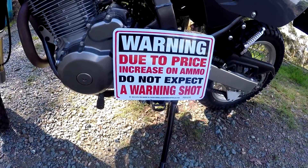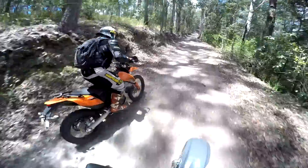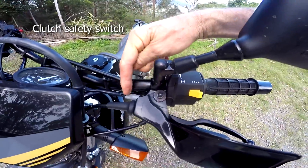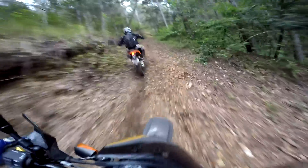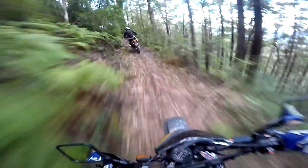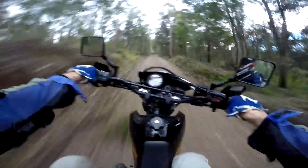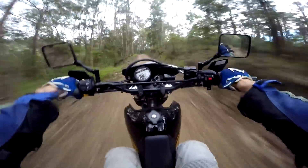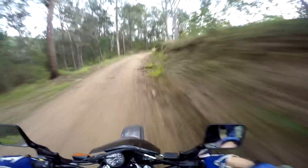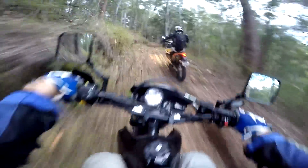Here are a few things worth looking at straight away on your DR. The bike comes with safety switches on the clutch and sidestand - the engine won't start till the sidestand is up and you've pulled the clutch in. These switches can and do bugger up. My sidestand switch failed when my last DR was only six months old. If your bush pig won't start, chances are it's these switches at fault, so always check them first. Or if you're prepared to bypass these safety features, just disconnect them.